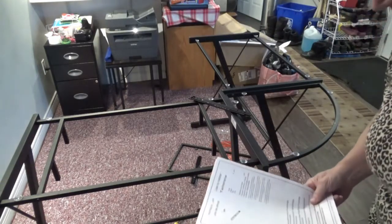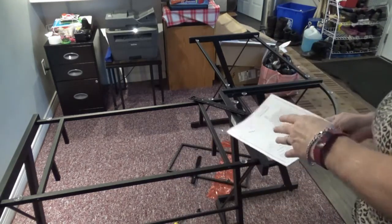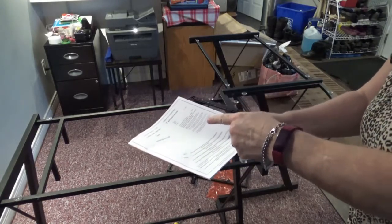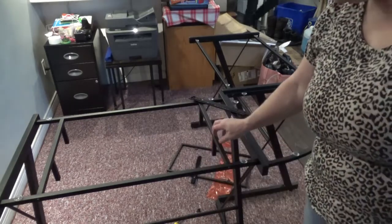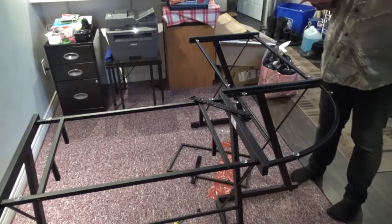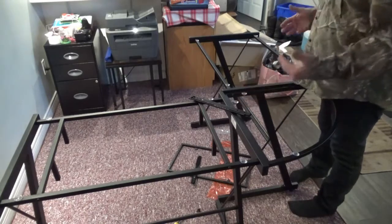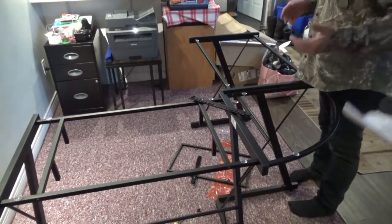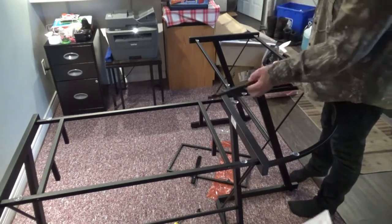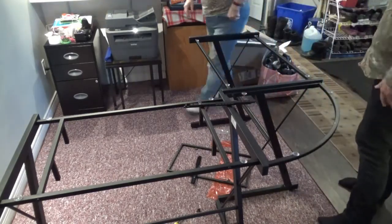Okay, so one part of the tray slider goes on the tray frame, and the other part of the tray slider goes on the tray support. And those things are greasy, by the way. They're very greasy, but do not spray them down with alcohol or degreaser. You'll muck up the bearings. You want them greased so that they go quiet and smooth all the time. If anything, just wipe down the thing with a paper towel. But you've got to keep as much grease on there as you can for longevity.